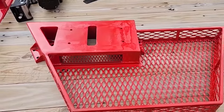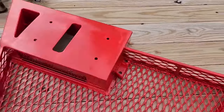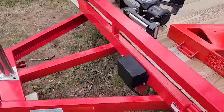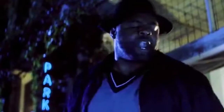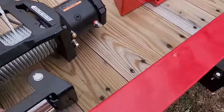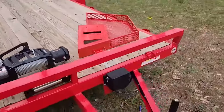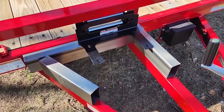Go down to your local hardware store — Lowe's, Tractor Supply, Farm Fleet — and pick up one of these little tongue mounts. Goes right up here in the front. If you can't find them, go down the aisle with the welders, get yourself a little welder and a grinder, some sort of saw — bandsaw, hacksaw — and learn how to do things. I need to raise it; I want to put the fairlead right there, so I built myself a little platform out of some scrap pieces.